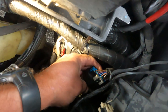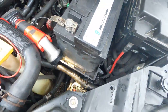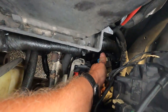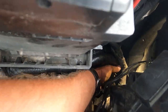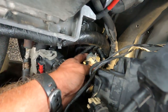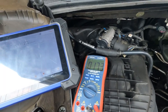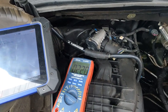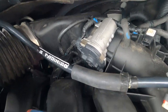On the opposite side you can barely see it, but we have a bunch of wires where we don't have wires on this side — that's a giveaway. I have black to black and gray to light gray, and the wire colors match up, so that's got to be good. Let's check our MAP sensor — always test your meter first — and I'm hoping to have five volts on that wire. Bada bing, bada boom.